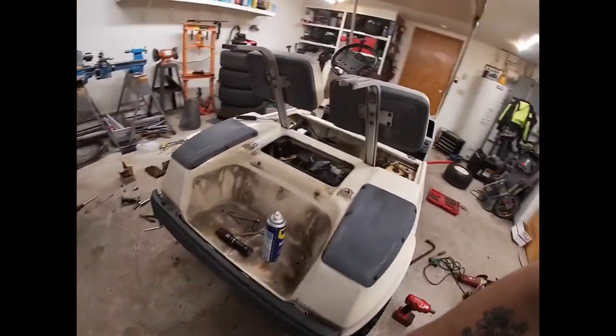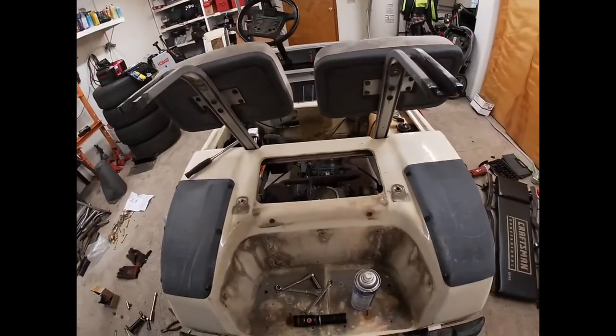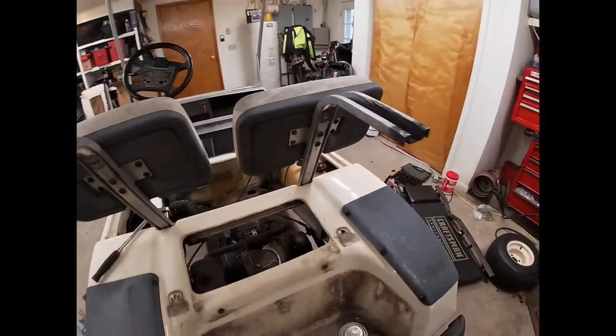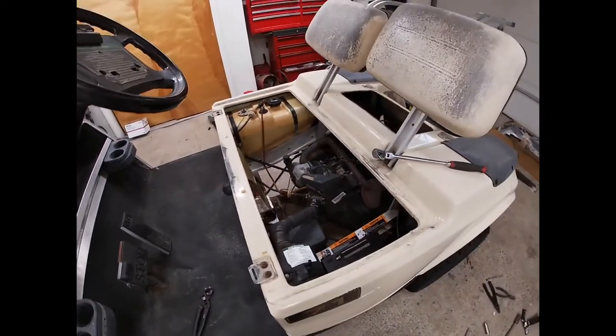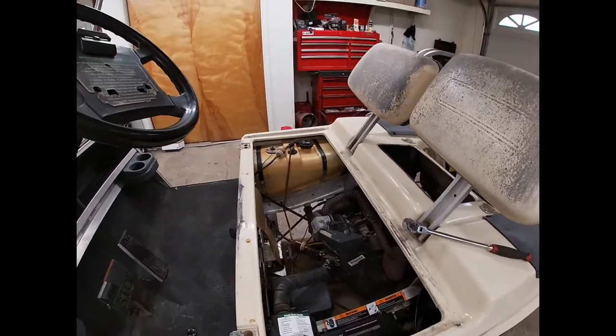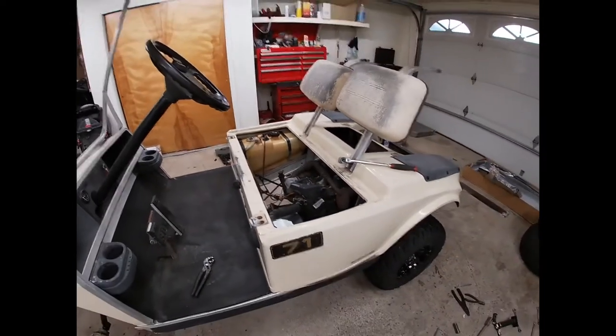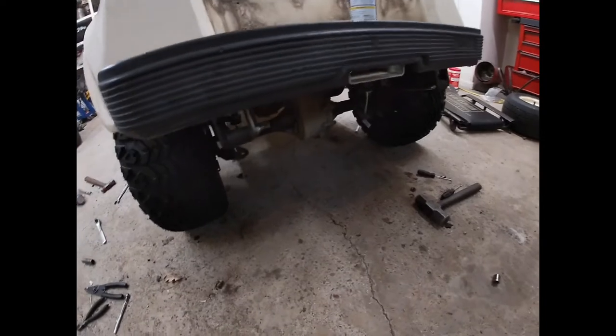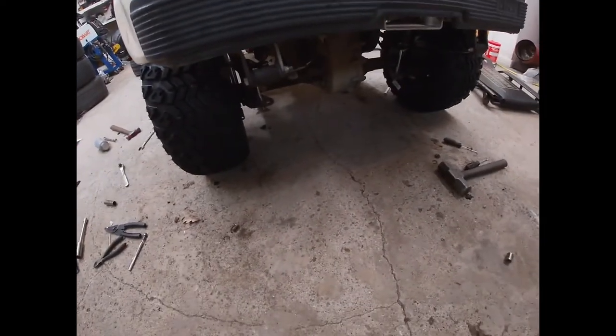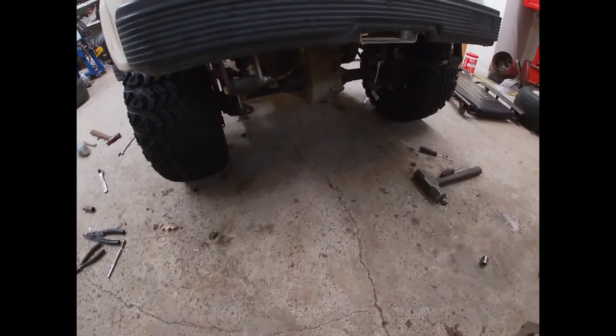I started tearing this apart to get the back seat kit on and get everything recovered. The engine snubber is definitely bad so we'll replace that. These things have a huge gas tank — I can't even believe the size of it. The kit honestly works pretty good — the only thing missing is their instructions are terrible. I'm also noticing the brake cables are going to be a little tight, so I'm going to see what I can do about routing them to get a little more slack.